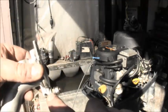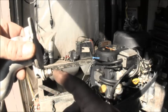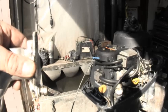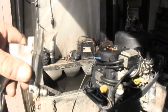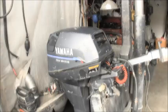Okay, and you see how I've got all these? I've got a flat washer, a nut, a lock washer, and a nylock sticking on my hinge pin bolt right here. The reason why, you see how that sticks out that-a-way, is it works as a counterweight because of all the weight that's sticking out here. It makes the thing want to open. When I draw it shut with the cable and then go to push it open, it'll want to fall. So you get the idea.